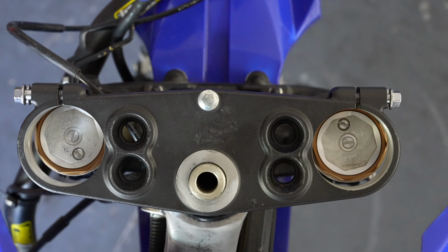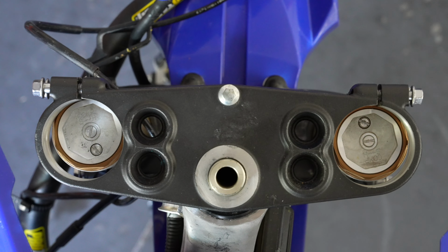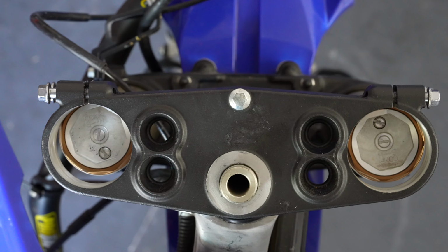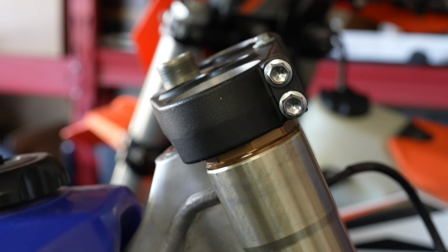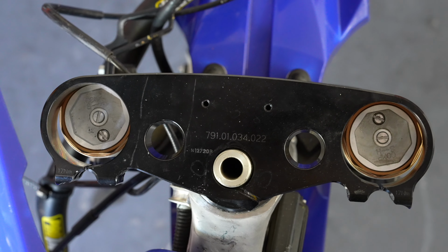And when it comes to handling, I was thinking about the 4-stroke YZ triple clamp. I tried to put that on, and I noticed how much offset that clamp has compared to the stock YZ triple clamp, and that's actually what made me think, they thought that through, and the modern 4-stroke Yamahas are handling very well, and that's the one that gave me thinking, it's something that definitely needs to be done or can be done. And then I put the KTM triple clamp on it, it's the same thing. So both of those clamps act the same way, with offset compared to the stock YZ triple clamp.